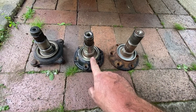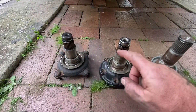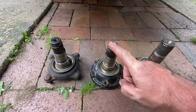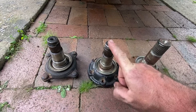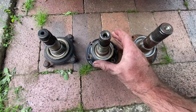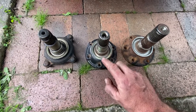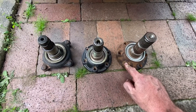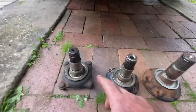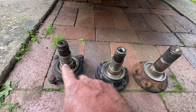This axle here - this spline is for 8-inch diffs. These two here, this spline, is for 7.5-inch diffs: Altezza diffs, LX diffs, NA diffs. This particular one has a smaller PCD - the diameter of the six bolts is a smaller PCD than the turbo one, and they're M10 bolts rather than M12. And then this one here is an LX axle - it's got four bolts, and it's got the spline to fit the 7.5-inch diff.